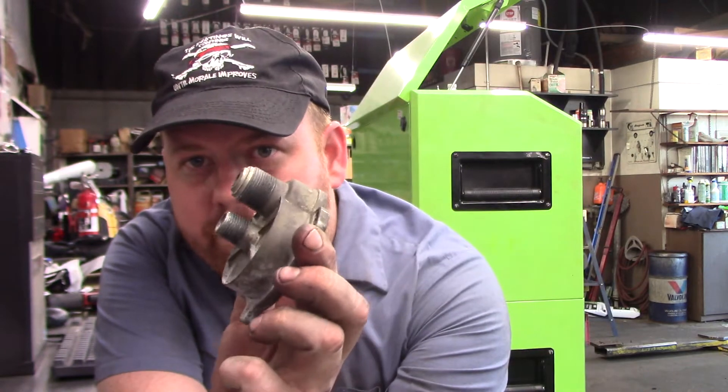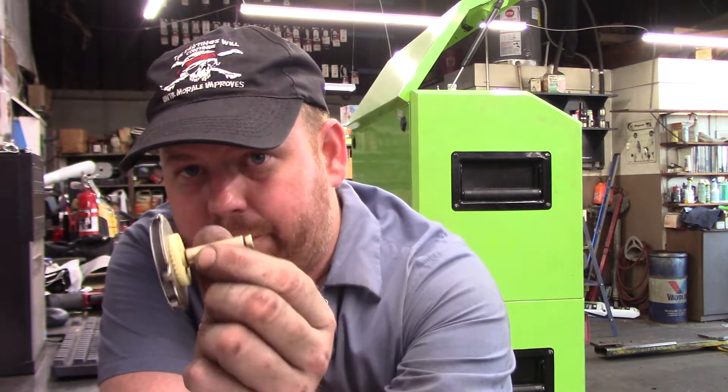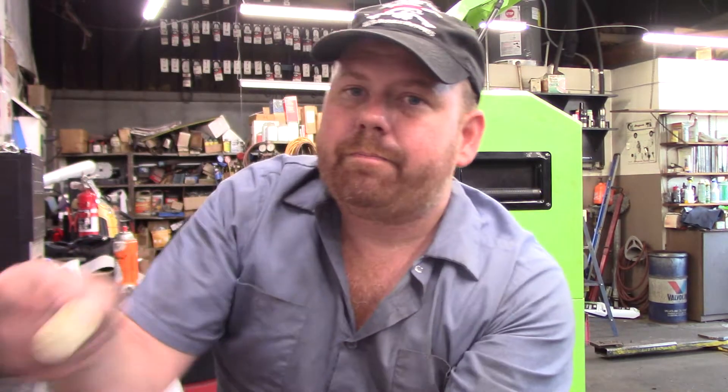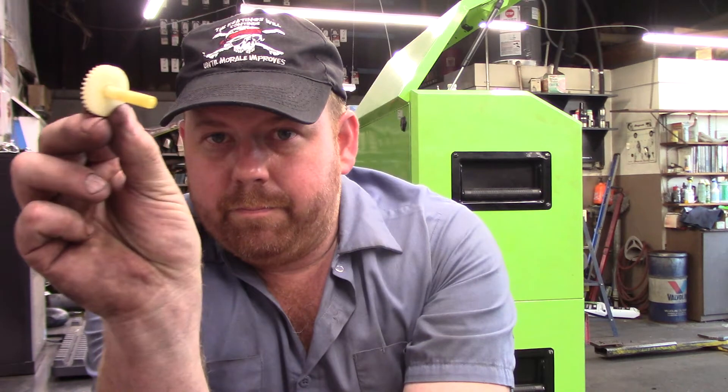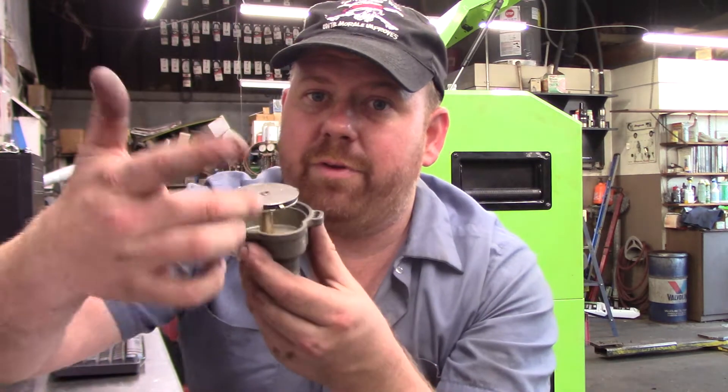In the geared part, you can see the cover, the gears, and one bushing on the top — I had to tap that one out because it was frozen. This is the speedometer drive gear for the housing; it sits in there and this is carefully pressed back in. The gear on the bottom drives that gear, so there's your speedometer drive. This spins off the transmission and turns the speedometer. There's a magnet in there — sandwiched between two fine pieces of steel.